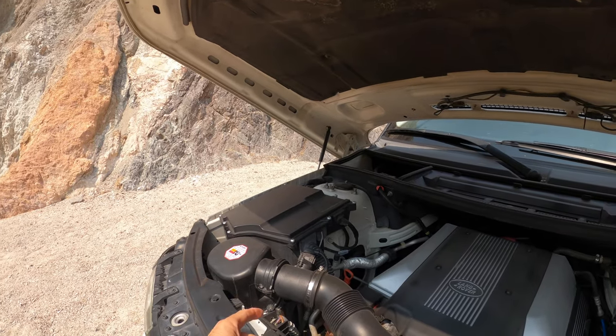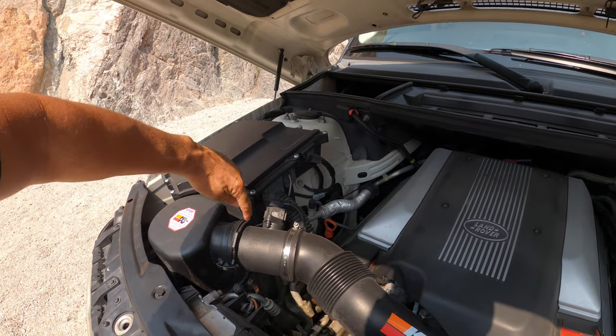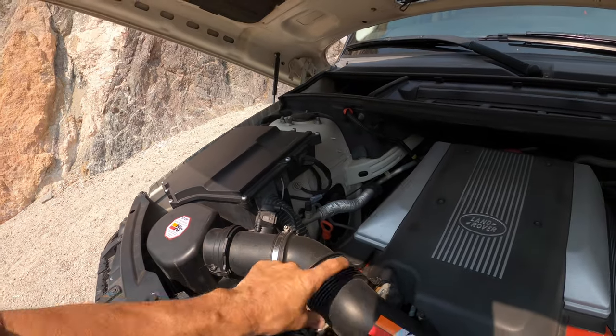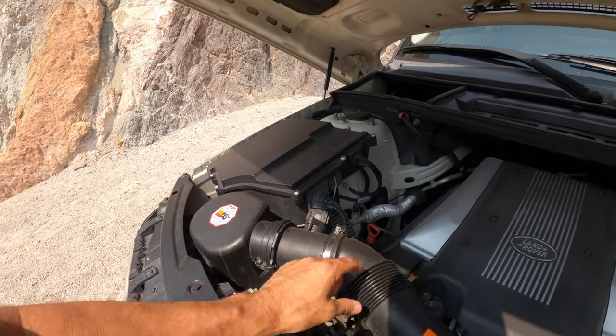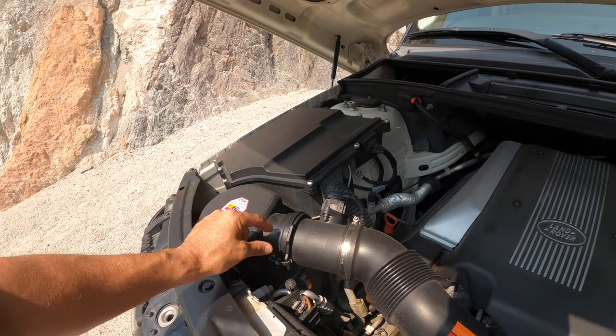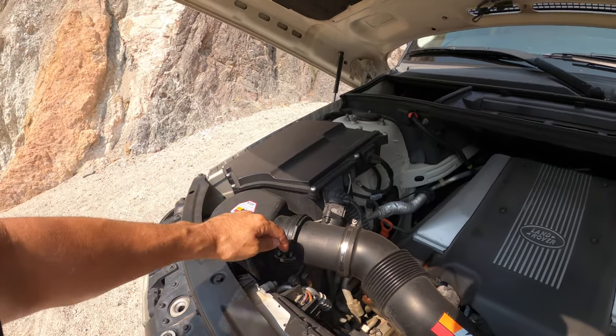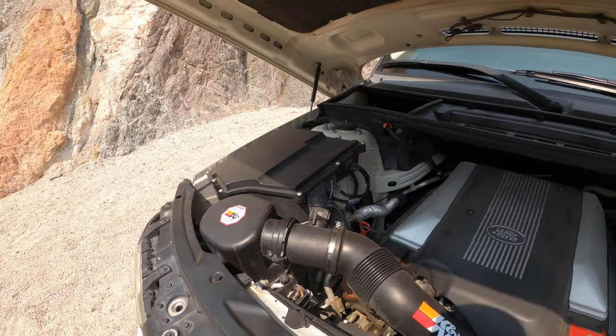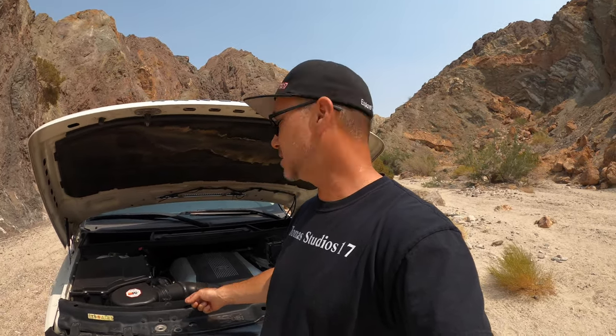So what it ended up being on this vehicle — right here, there's a rubber gasket inside this connector. This part comes off; you unclamp these two clamps and the piece comes off this part of the air cleaner. You pop this off and there's a little flat rubber gasket in there. I siliconed it — I figured I'll just silicone it — so I threw a bunch of silicone right there. And voila, easy fix. That was the easiest fix. It's been a month since I did it and it worked — the O2 sensor check engine lights all went out.